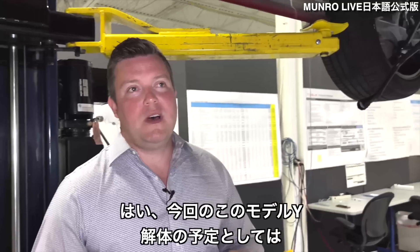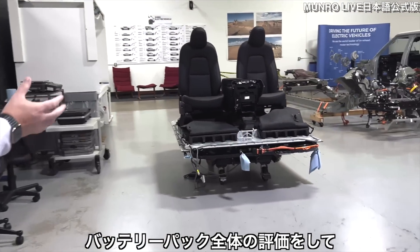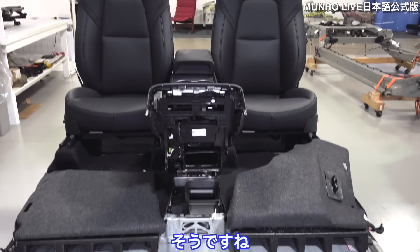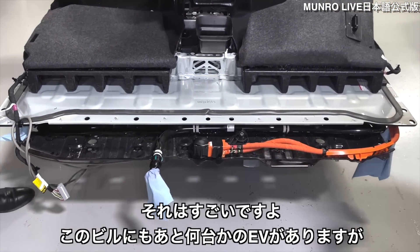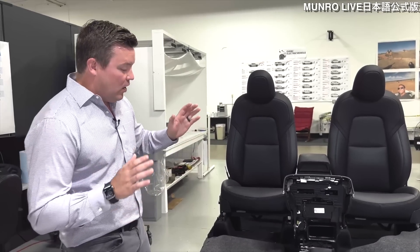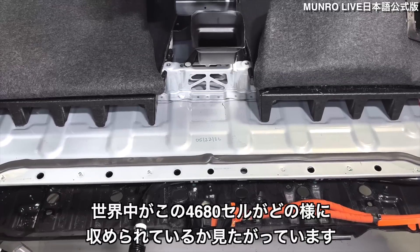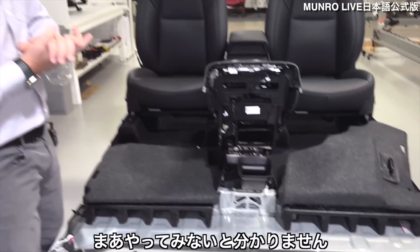Our plan for this Model Y is to first get that battery cover off. Our next steps are removing the carpet, the center console, the ducting, and the seats. We're going to do a short assessment of the pack itself minus all of the lines and the cooling tubes. This weighed 1,198 pounds — with everything you see here. Which is incredible because other EVs we have in this building, like the Rivian, the batteries will weigh twice that — just the batteries, no seat, no carpet, no trim. Our goal this week is to get this top cover off. The whole world wants to see how they're actually securing these 4680 cells to the top cover. We think it's probably going to be very difficult to peel this cover off, most likely destroying the cover.